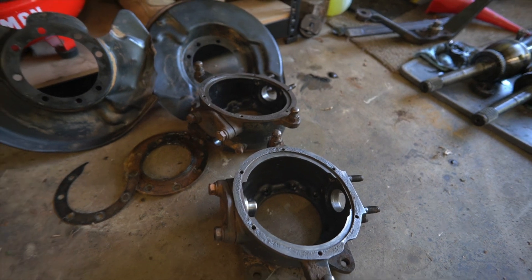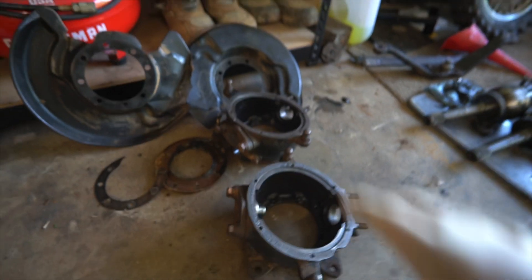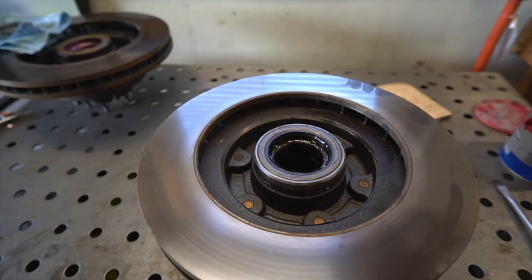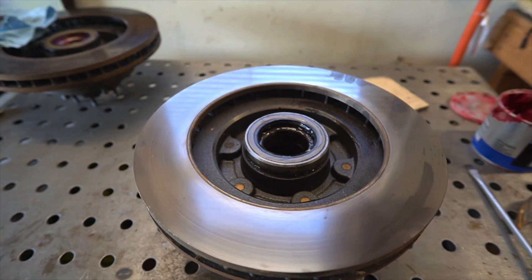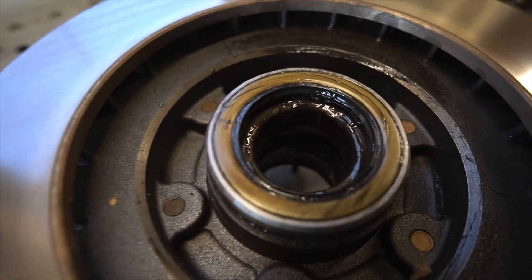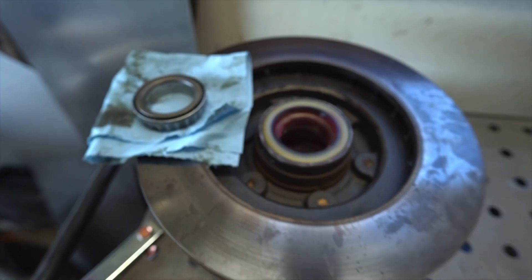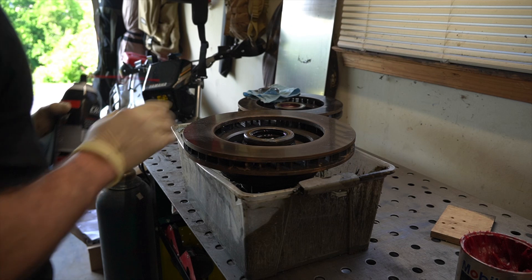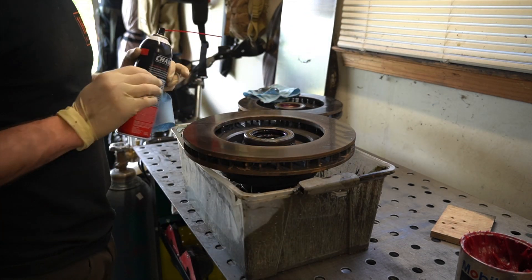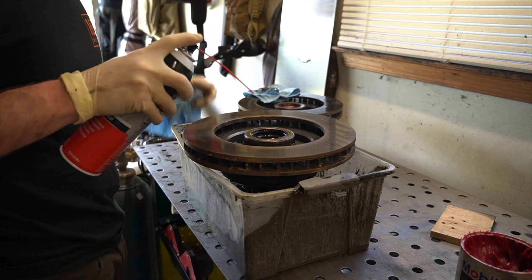To clean these knuckles up because they were so nasty, I ended up taking them out to the driveway and pressure washing them — got completely filthy because water shoots back at you — but it cleaned that stuff up pretty awesome. Now, I did the front wheel bearings previously not on video, so the bearings are good. I'm pretty much just going to take this apart, get all the diff fluid that leaked in there out, and repack it with grease. When you pull it out it looks really nasty — discolored, a slimy mix of diff fluid and grease. After cleaning and repacking it'll just be fresh high-temp grease and a nicely packed bearing.